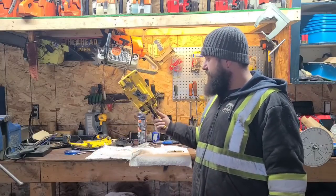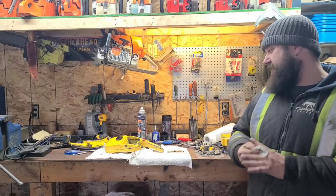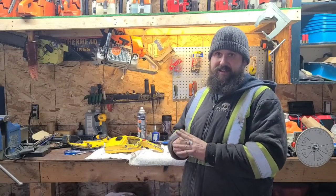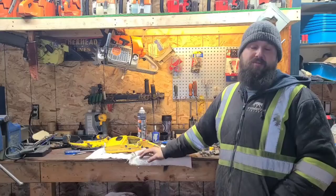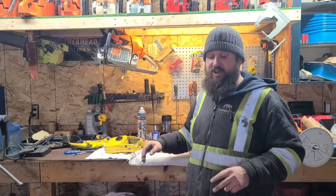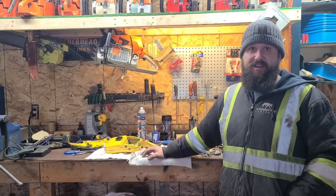Okay, McCulloch fuel tank. This is my attempt at repairing it. Hopefully it works. And next time you guys see this saw, we'll be back together and in the wood. The next video of this saw is actually, I shot it previous to today, and I went cutting. Was not happy with that chain, so the saw rips, but the chain was not doing the saw justice. So I reground that chain today, and some of these ported saws, guys, all ported saws like a sharp chain, but some of these ported saws, it really pays to work on your chain. They'll all cut well, but if you're really particular about how fast and how well your saw cuts, putting a good chain on a warm ported power saw, especially one that's fast, will absolutely change night and day.